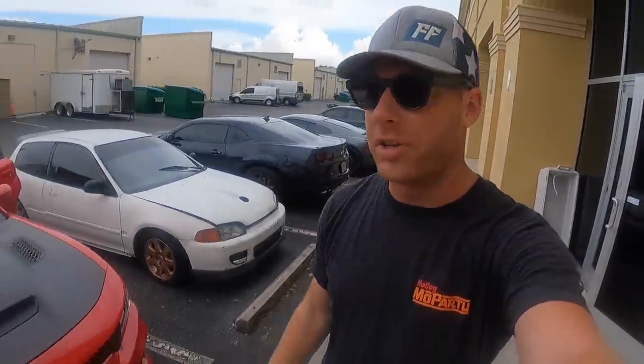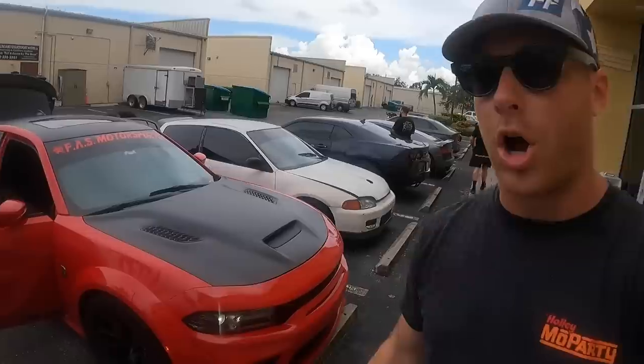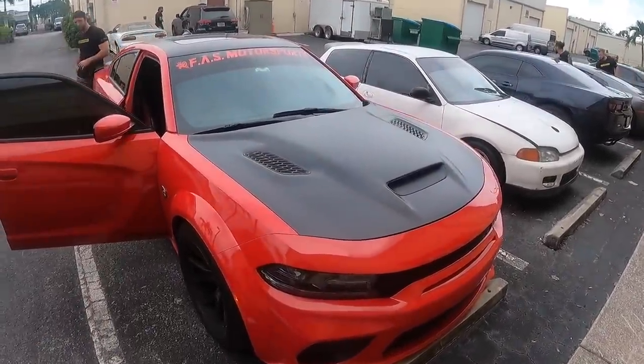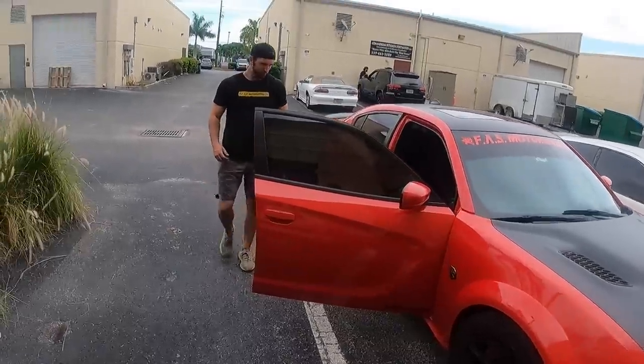Last time I was down here at Shop Hellcats — I don't know if you all remember this car — this is a Hellcat with a 4.5 liter Whipple on it. It's good for 10.90 to the wheels, right? It's still on the big pulley and we can't get it to rev past stock RPM because the newer computer is kind of finicky. Should get a Holley on that rig. It's making the bare minimum — 10.95 is what it made, but it should make like 11.50 to 11.80. It's still on the stock motor.